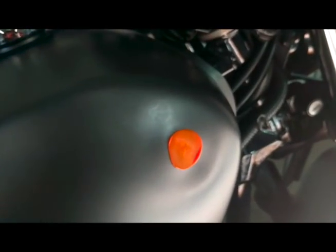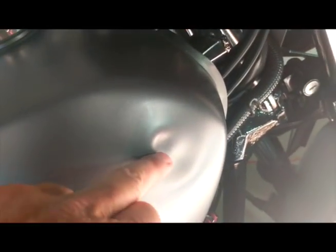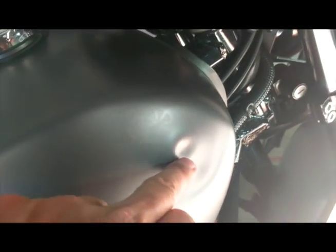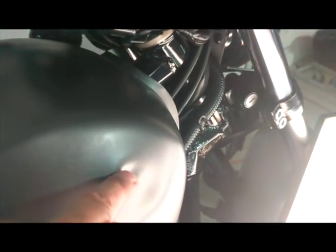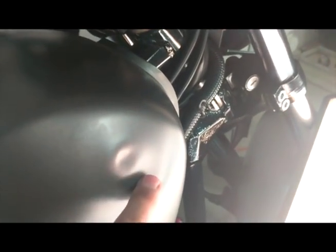This one I did get a snap to get that tab off, and it appears that the paint is still intact. So, all right. Okay, so the tab is off. You can see that nasty low spot. That's going to be hard to release, but I will knock down the crown around there and the crown around here. Knock this down. We do one more glue pull along here before I do so.